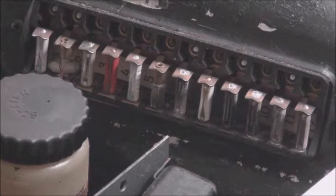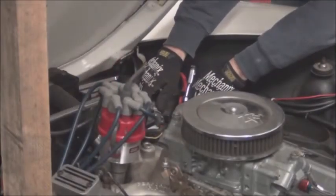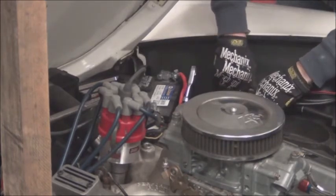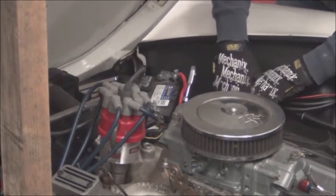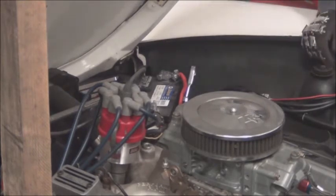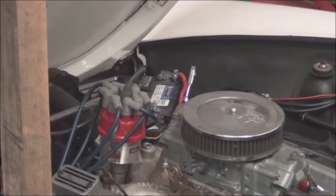So it looks like number 4 is the red fuse right there. That operates the electric fuel pump. We'll just pull that one and turn on the ignition and verify that that is the electric fuel pump. As with most automotive jobs, first thing we're going to do is remove the negative battery terminal, so that when removing the hood or whatever, pulling out that fuse, anything we do, we don't have to worry about shorting something out. So that's like job number 1.